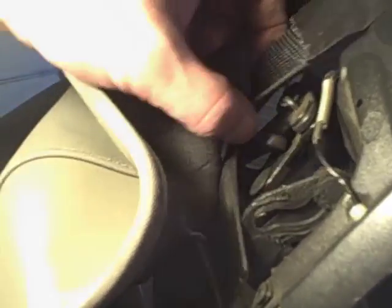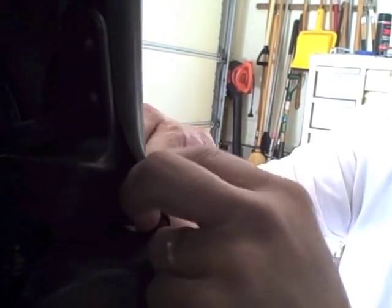Okay, next step is to get this rivet strap out right here. This is on the side. Back up so we can see this part right here. So this strap, we're going to drill that rivet, pop it out to get this off right there. Okay, now we got them off. We're going to have to take this rubber channel off to get some more screws, and these are the same kind of way. All right, so we'll do both sides of that.